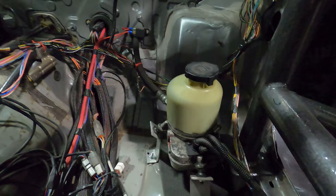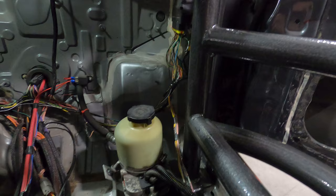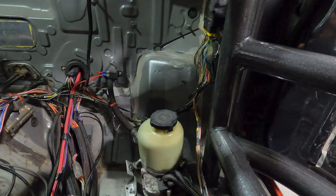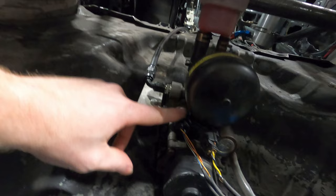This is an Opel Astra power steering pump. I had a custom line made locally, and all it needs is a power and ground and two 12-volt switches to turn the power steering on. It works great for road course driving, but for autocross it struggles a little with quick back-and-forth turns — you get caught every once in a while.